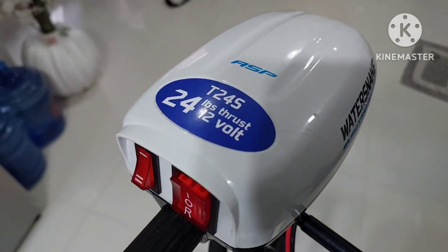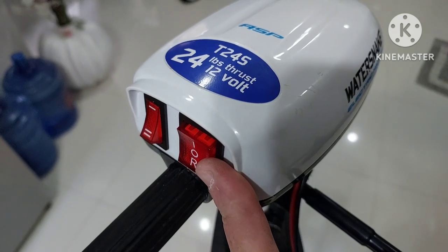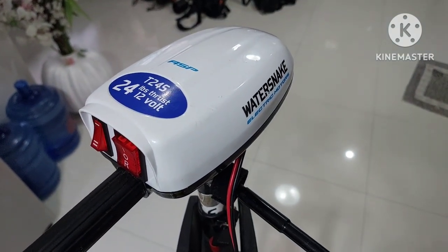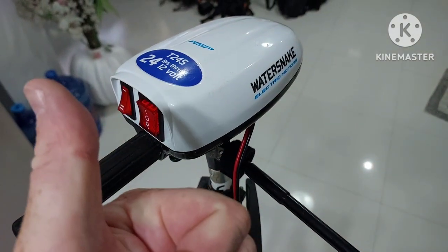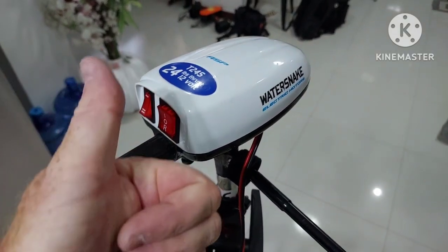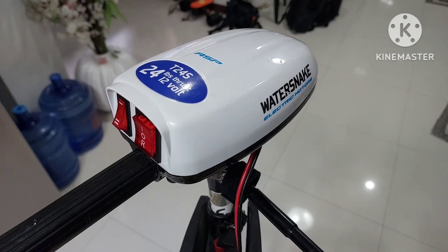That's how you change the switches on this motor. Remember there's no capacitor and no fuse — if anything goes bad it's probably a switch, or maybe your battery spiked and melted your wires. It's a simple fix — just make sure you put the wires back where they go. Shout out again to Mike Patrick from Water Snake, the customer service rep who took care of me. He took my pictures and receipt from Amazon and immediately sent out the replacement parts. That's why I buy from better companies that stand behind their warranties — great job Water Snake. I'm going out on the water tomorrow! If you liked this video, give it a thumbs up, like, and subscribe. Check out how I have this mounted to my paddleboard — it's pretty cool. See you next time!